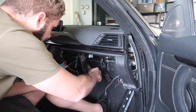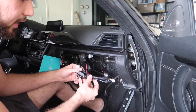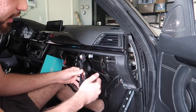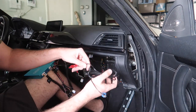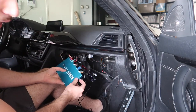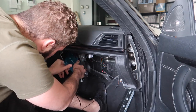Now we have everything connected here. We can pretty much shove all the wires back in - this is where the MMI is just going to rest. We have two more cables to connect: first, the USB port needs to be accessible. We don't need a backup camera or anything else, so we literally just need the USB. Connect the white cable for the USB into the MMI, and also go ahead and connect the antenna cable. Make sure you have switches one, two, and three on, and four, five, and six off if you have the biggest screen.